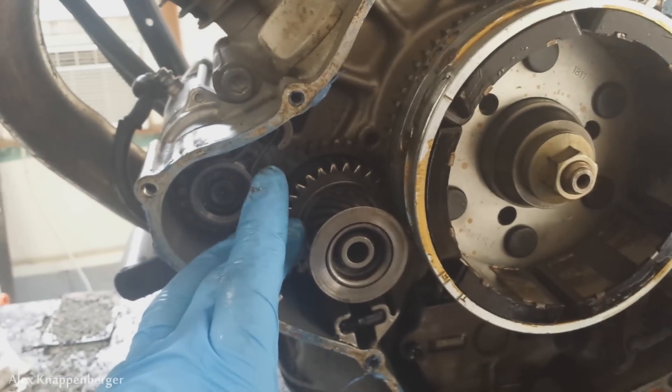This is the ultimate Virago starter tip right here. Now something else you'll want to do — check the dampener on your gear. This is what slows it down and pulls it off the flywheel. The tighter this is, the faster it pulls off the flywheel, saving it from wearing down quickly and reducing the racket as it comes back in. If yours moves around too easily, you can put a zip tie — maybe a stainless steel one — right around it to squeeze it a little tighter and give it more tension to pull back sooner.